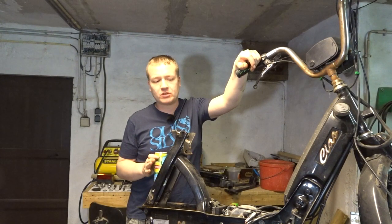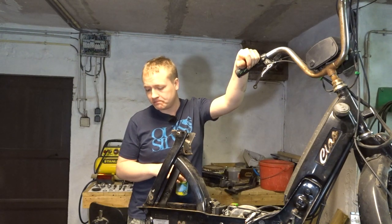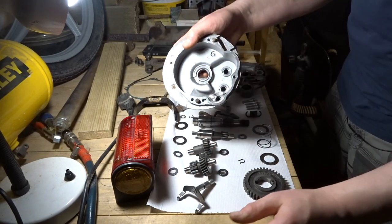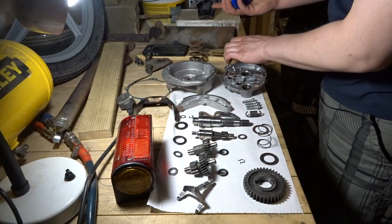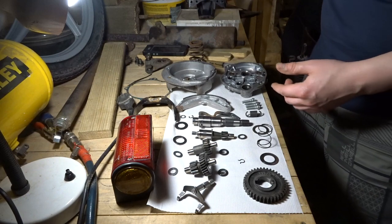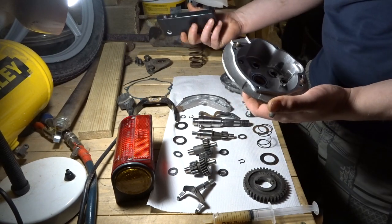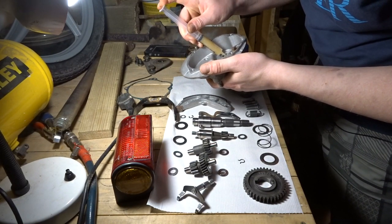There was a time I thought I was going to do a simple cable lube job — that escalated quickly. So now it's time to put back all this mess: the gearing. There are bearings right here, so I've got this syringe filled with bearing grease — I use Griffin bearing grease. If you're interested, go get this. This is not the final assembly. I took a video while taking it apart — when you're doing something you've never done before, always do that. First I'm going to put some bearing grease in here.